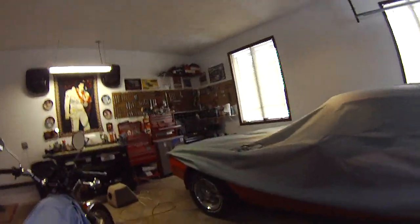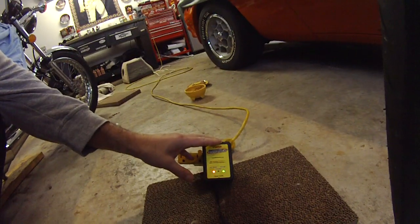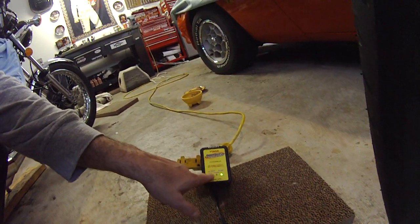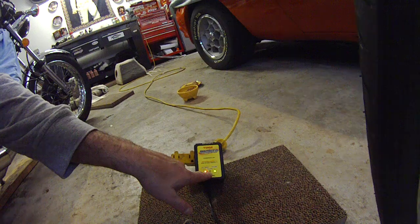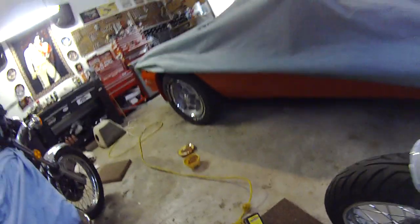least ready to ride. Here is my little trickle charger / tender. This is a Yuasa. Picked it up at the bike shop. Costs about 30 bucks. You can see the 3 little LEDs. That indicates the power on. If that were lit, which is yellow, it would indicate that the trickle charger is charging, and storage means that the battery is topped off and it's just being maintained.